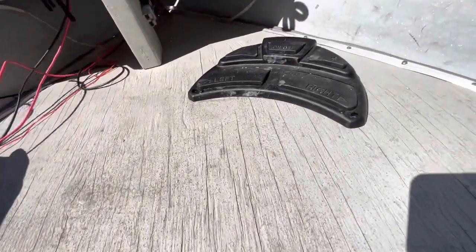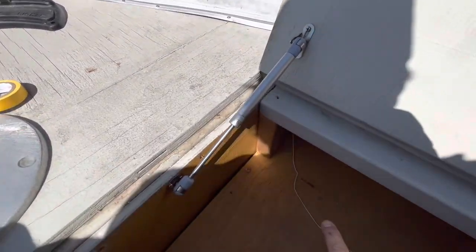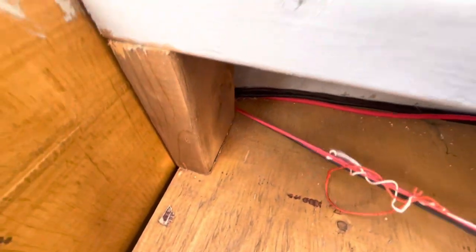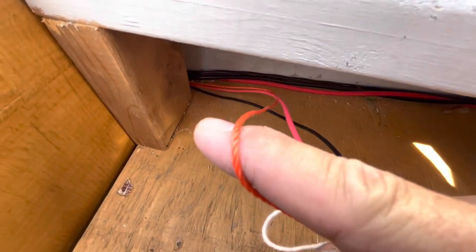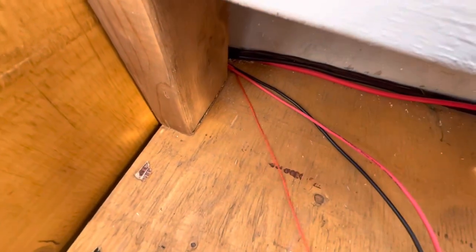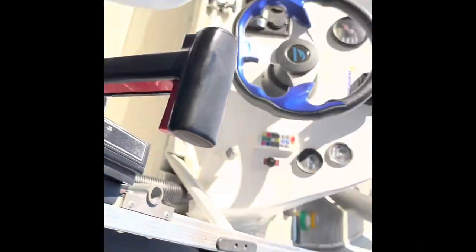The white wire still comes out and I've attached the orange string to it, so a new string will be left in place in case you need to pass new wire later on. I'm gonna pull my string now. Started passing the wire — always feed it in from the front. You don't want to pull on the string too tight or it might break. Once you're close to the end, grab your string — look at that, everything came through.